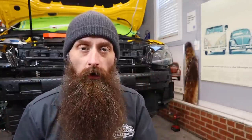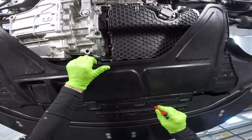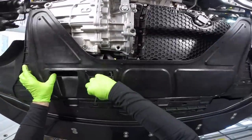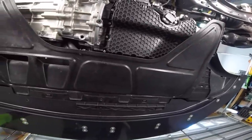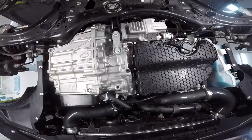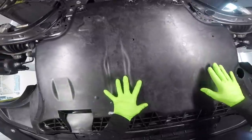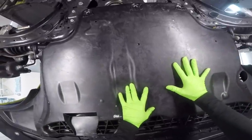One of the beautiful things about the MQB platform is so many things transfer over to different cars. That means we can get rid of the floppity belly pan that comes on the Golf R and put a pretty awesome reinforced pan from the Alltrack on it. As you guys may or may not know, this car has a plastic oil pan, and that makes myself and plenty of you guys uneasy, all the way up to terrified. There are metal oil pan replacements if that's a route you'd like to go. But even then, the belly pan on the car doesn't cover the oil pan, so if something pops up and hits it, you still have the potential for a leak. The Alltrack belly pan is not only reinforced, but it covers the entire section — the oil pan, the whole transmission. We don't have to worry nearly as much about it, and it installs pretty straightforward.